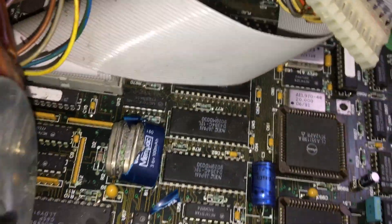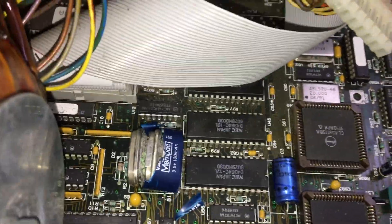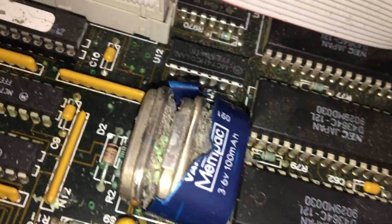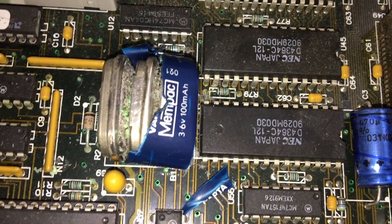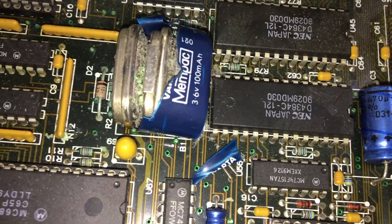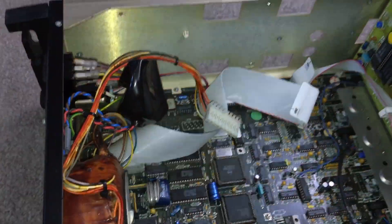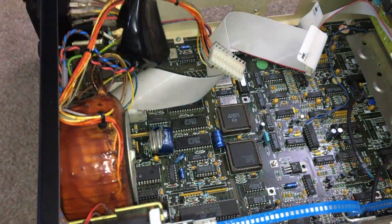What I'm going to do is remove that. We've actually already removed the PSU because I checked all the caps on that first. So we're going to remove the board, desolder that, get rid of it, and because it's been leaking there's likely some contamination of the board underneath — you can see just a little bit of green. We will neutralize that with vinegar, wash the board off, dry it in the oven for a bit, then reassemble and see if it's going to work. Hopefully it does.